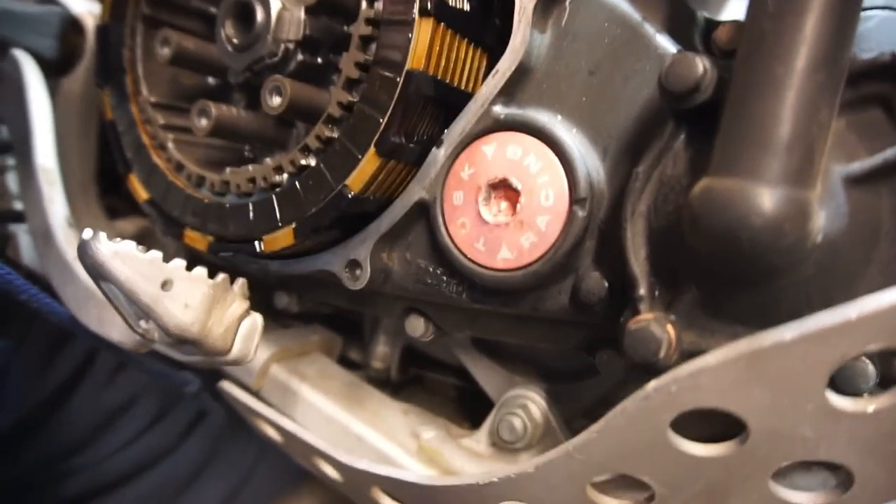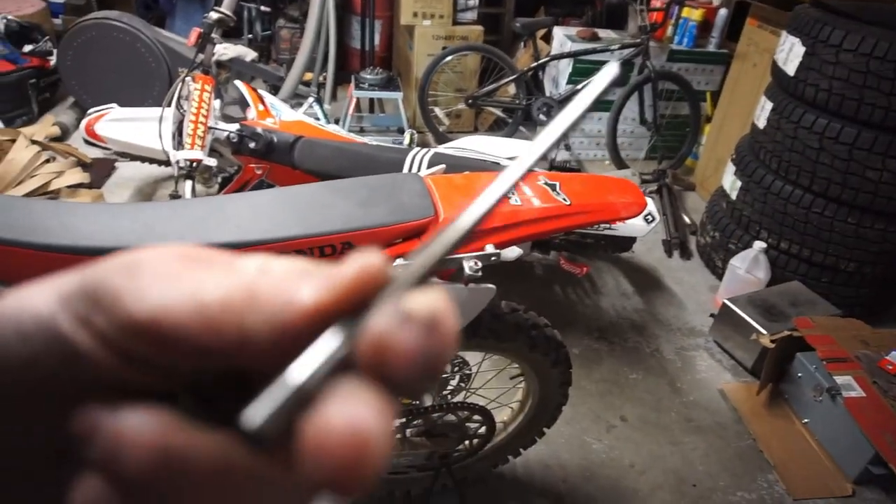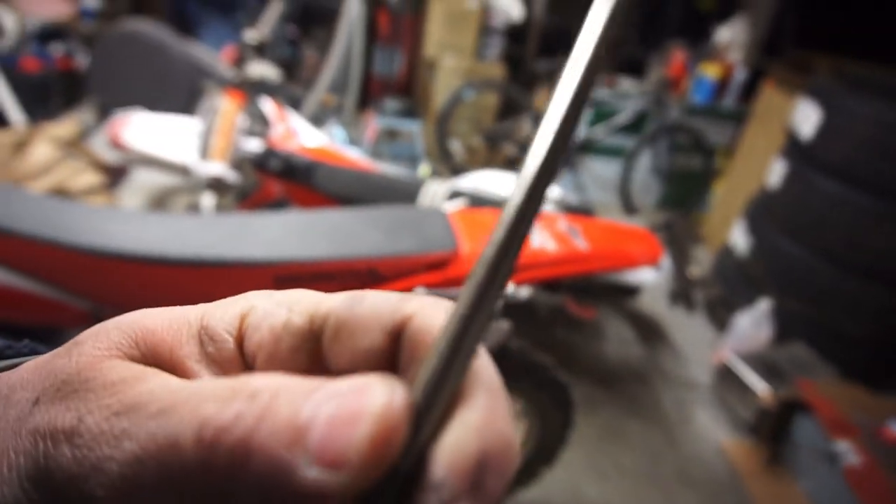Okay, it's back in — I did a little reach around and stuck that thing on there. Now the rod: what I ended up doing is — because this side is pretty much brand new — I'm going to stick this side on the clutch side and drop that worn side in. You can tell by the wear mark that the wear is from the thrust bearing.